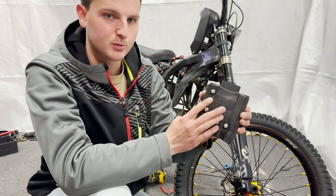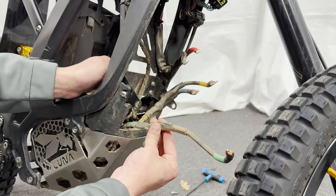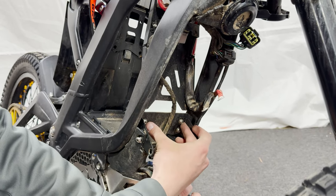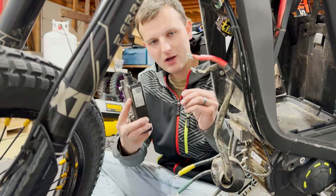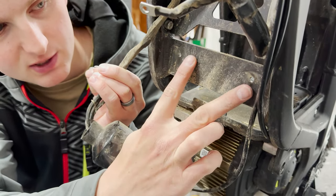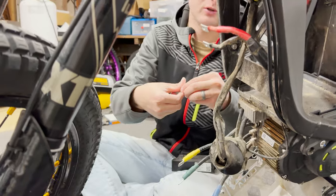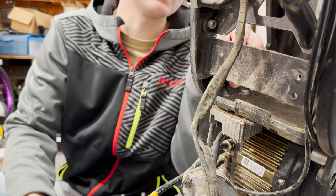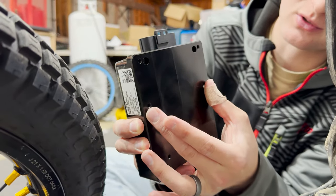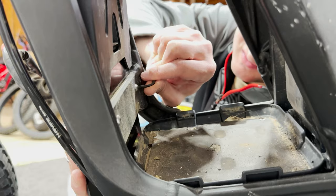We're going to start by installing the controller portion. We'll get our wires out of the way — these are some extenders that were on the BAC controller that we're removing because we don't need those. We'll also remove these two metal brackets. Our controller actually mounts straight to the frame on this plate. We're going to use the two top holes and the two smaller screws provided. The top holes are a little bit bigger than the screws, but they'll go through and mount to the two middle screws on the frame. It will sit totally flush — line it all up and screw them in.